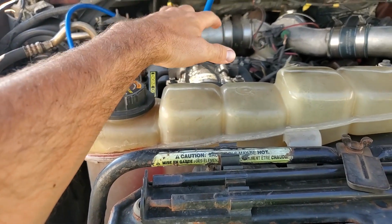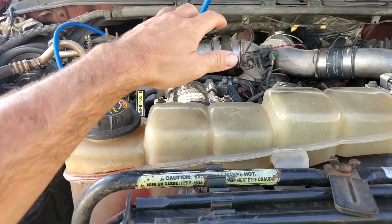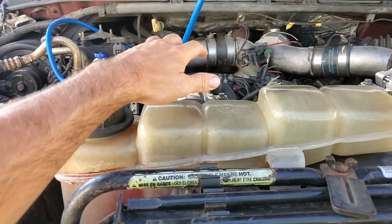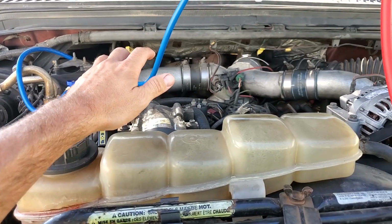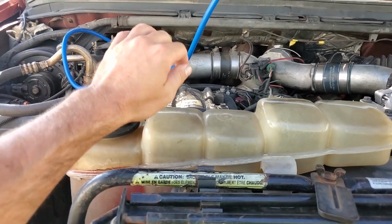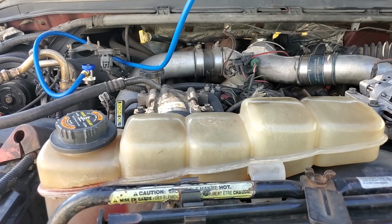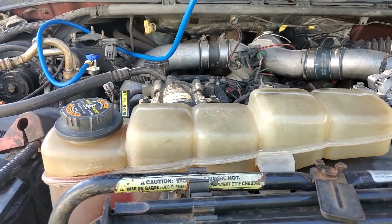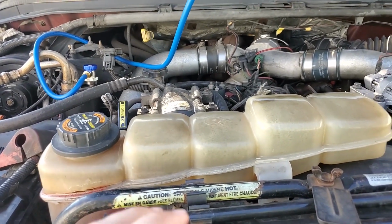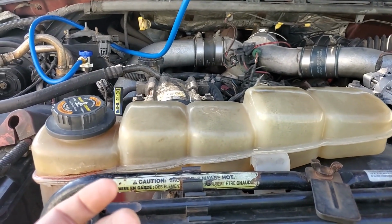So that tells me that the compressor is getting worn inside and it just can't build enough pressure to have the system work properly. The low side is perfectly fine at 55, which is interesting because when I recharged it a few weeks ago, my low side was actually high, but the high side never really changed. So looking at this again, it's still just confirming to me that yes, the compressor is getting weak.